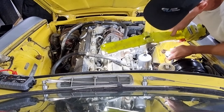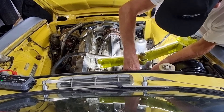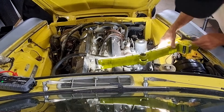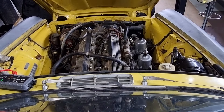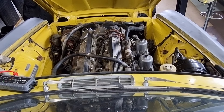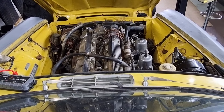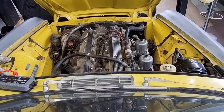We've got everything connected up to it - we've got a new little fuel line on there, we've got the choke connected up, though I don't know if that works. We're just going to check for leaks. I'll turn on the ignition - pump's pumping. It's leaking a little bit from that AED again, and she was overflowing from the carburetor. I think the needle must have been a bit sticky. I think that can be tightened up just a little bit in that flange there - not too tight, just a little bit. That wasn't tight enough - that's a bit better. No leaks.